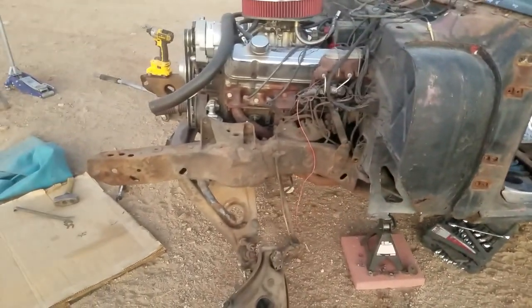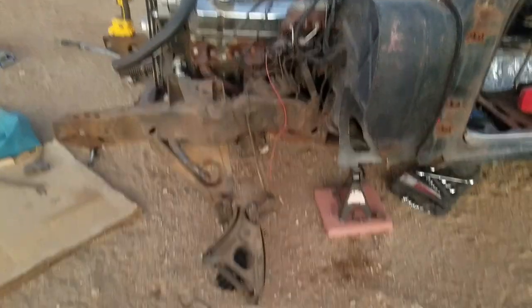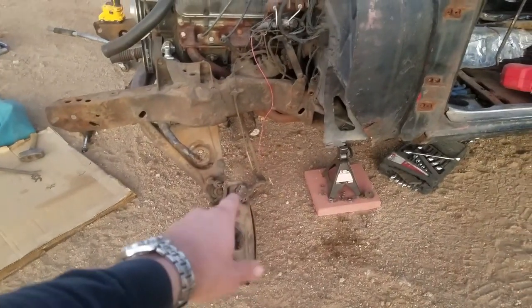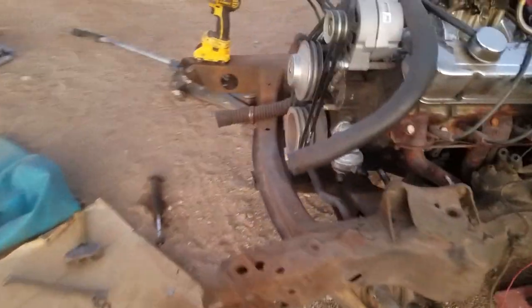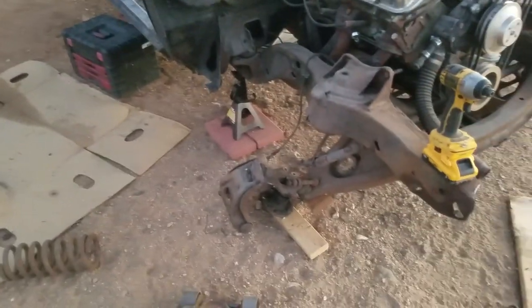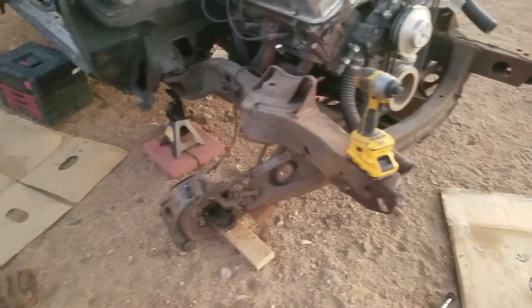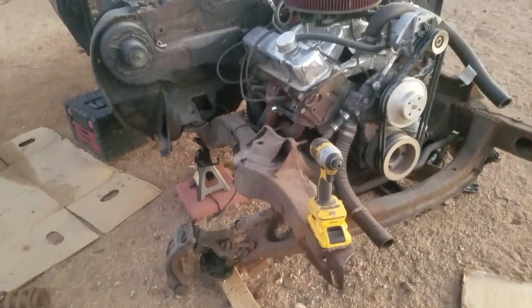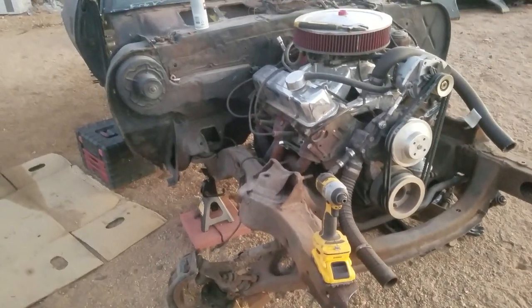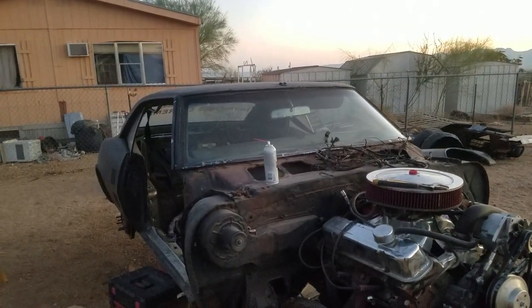There are pictures and stuff on Instagram — same page, same name as this channel. I do plan on replacing the upper control arms with BMR, with tall ball joints and delrin bushings. For the lowers — replacing the uppers gives an improvement in geometry. The lowers will either get rebuilt and boxed or replaced too, because the bushings are gone, just like the body bushings.